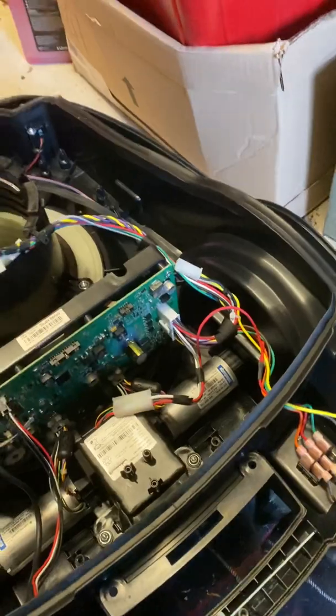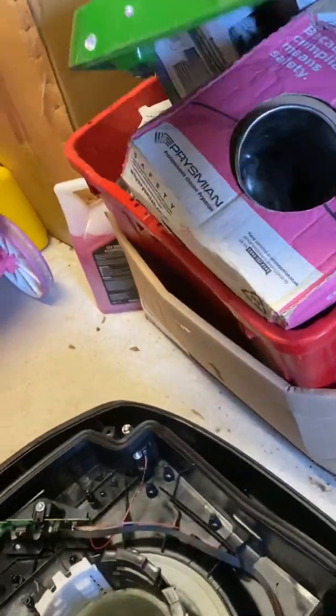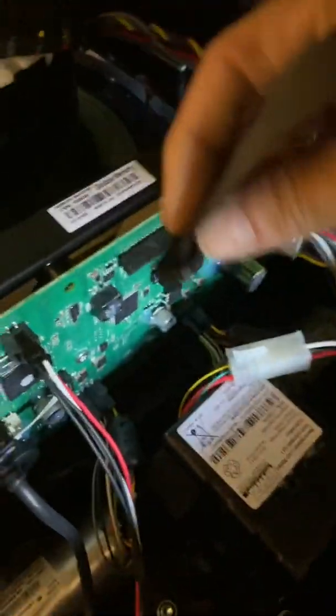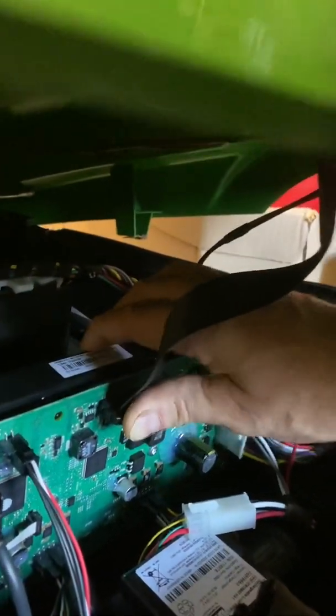You're going to do this in reverse, so when you get to the end you'll see me putting the power back on. The lid here sits on top and there are two electrical connections to be made. You've got a small power lead that connects in here, and there's a ribbon cable that just comes into the circuit board here. That's the two connections to the lid.